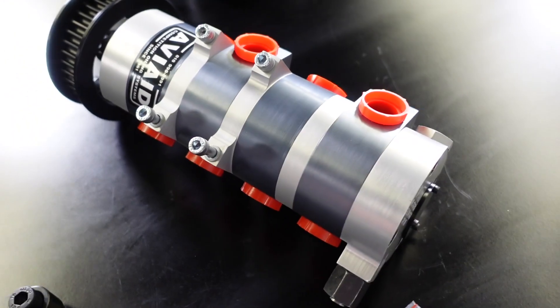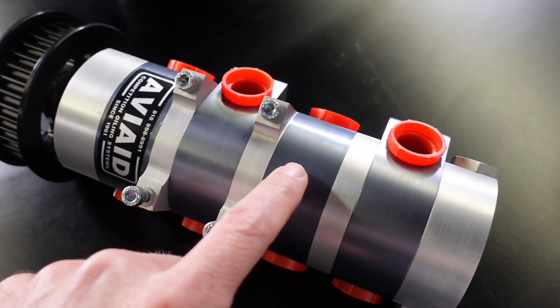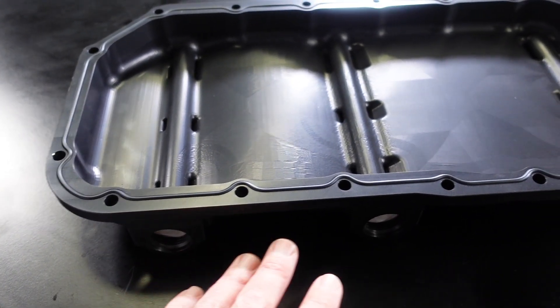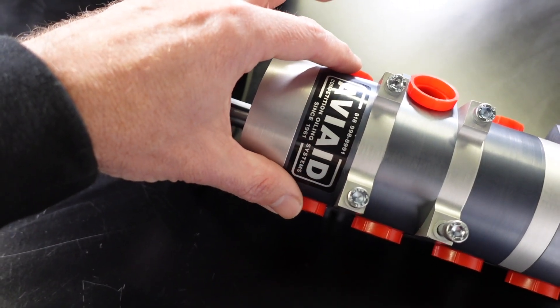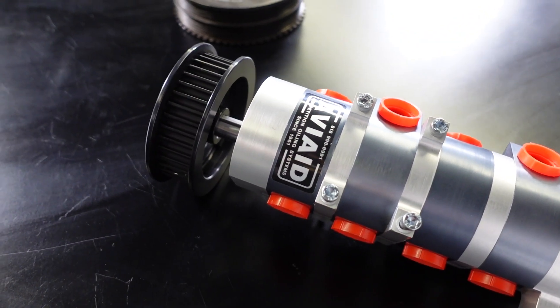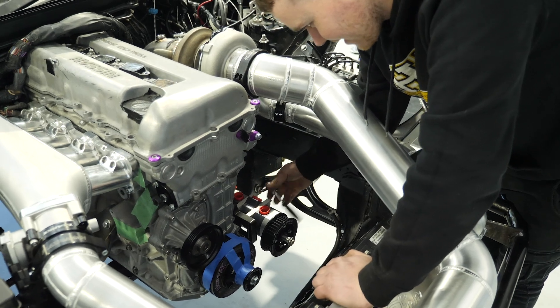Next up we've got the pump itself. This is referred to as a four-stage pump. We've got three stages — one, two, three — which are called scavenge stages. As we've already talked about, those suck the oil as well as the blow-by gases out of the sump. The fourth stage, which is at the front, is our pressure stage — this is responsible for drawing oil from the reservoir and then pumping it through our engine. There's no golden rule as to how many scavenge stages your dry sump system has to have, but this brings us to one of the other advantages: it's not just about improving engine reliability — done correctly, it can also improve engine power and performance.